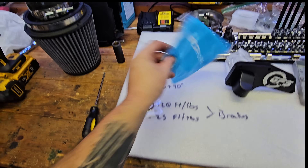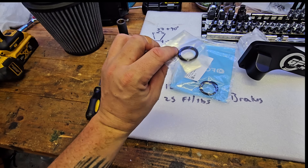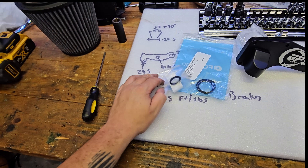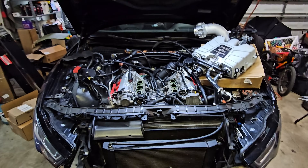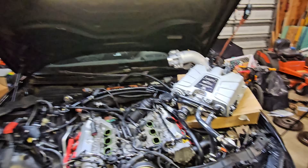Some other things you're going to need to buy: you're going to need some crossover coolant pipe gaskets, including a third one for the middle of that crossover coolant pipe. I've already done quite a bit of prep work — you will need your supercharger removed for this, and you will need your car in service position. If you don't know how to do either of those, check the pinned comment below the description for links to videos on both.